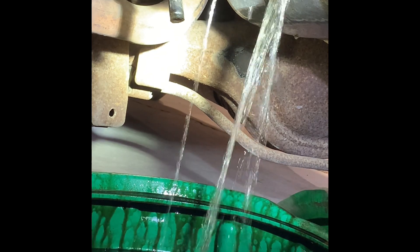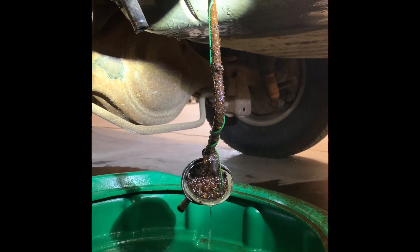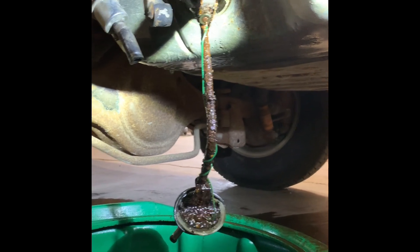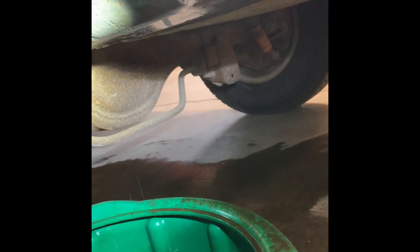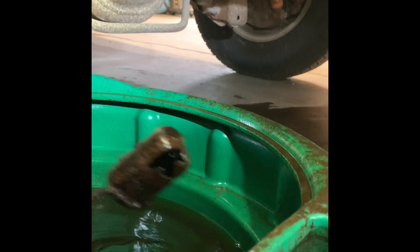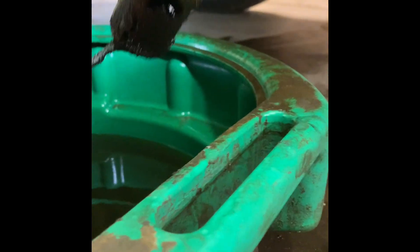I'm going to sit here and watch the gas drain. I've got bad news for my customer — the entire inside of this fuel tank is completely rusted out, not just this fuel sending unit here. Let me pull this out and show you something: that's the float for the sending unit. Things that have holes in them don't normally float. It's also missing the pickup screen. If the rust didn't ruin it electrically, it definitely ruined it mechanically.